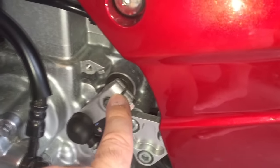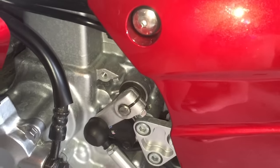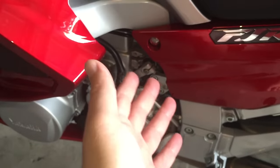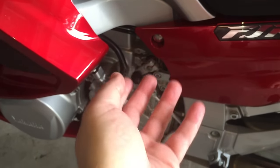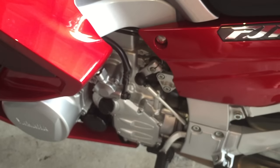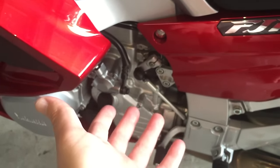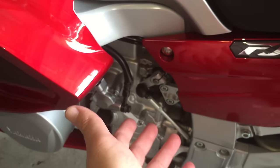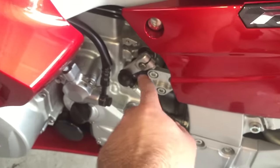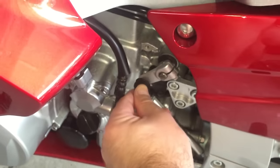We just have to get this out of the way so we can pull it off and get to that top screw. It should be kind of like a barrel design. The way it works is basically — this is a five-speed transmission — it's got six switches that ground out to indicate what gear or neutral it's in. I'm just gonna check the continuity. If anything appears to be broken or not conducting well, it's probably pretty sealed so I'll just replace the whole unit — it's something like 30 bucks.